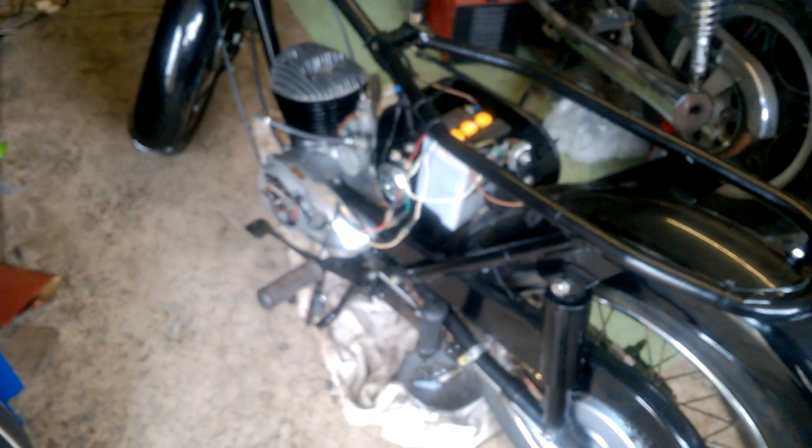Also, the nut that you sent me through for the exhaust — that's the one I've got in there at the moment — and as you can just about see, the one I've got in there is just a tad too short; there's no thread showing. I've also got to be able to put the seat lock on — I think the seat goes on that side — so I need like another quarter of an inch on there. Unfortunately you sent me a UNF rather than a BSF, so I suspect that was just a packing mistake. I can send these back to you if you want them, but there we go — that was the problem I had with the locking ring.